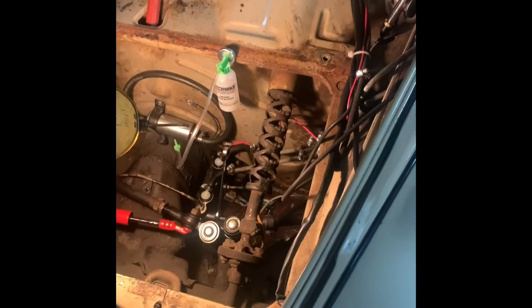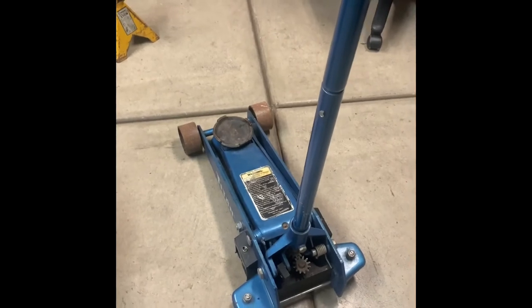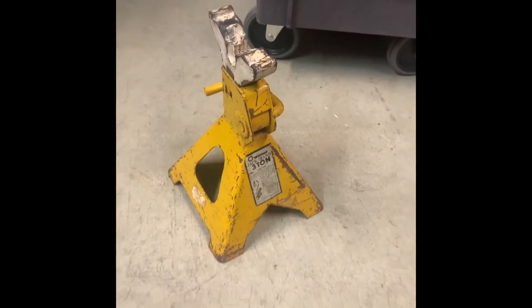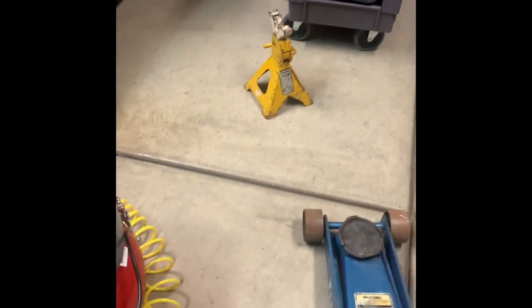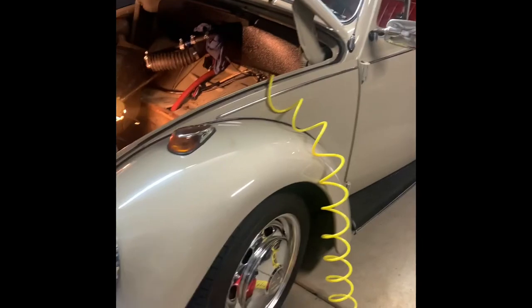Once you're done, you can save the drilled cap as a tool. Put your original cap back on the reservoir and you're done — no air in the brake lines and you've got good tight brakes. That's how you pressurize your brake cylinders and brake lines to purge all the air out. Get yourself a floor jack, lift up each corner as you work underneath, make sure you have a jack stand under there for safety, a pair of safety glasses, and plenty of lighting.